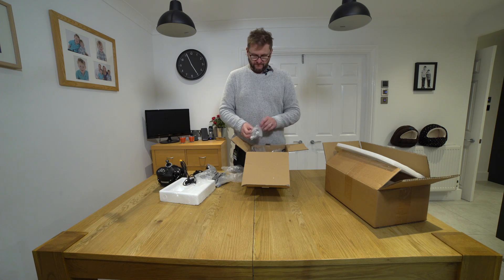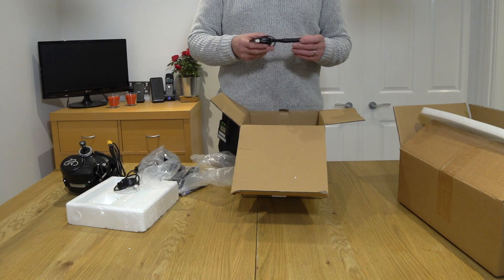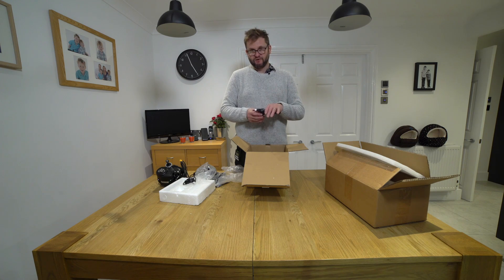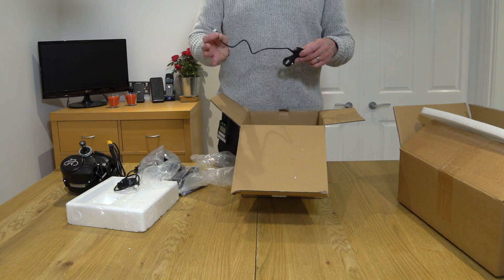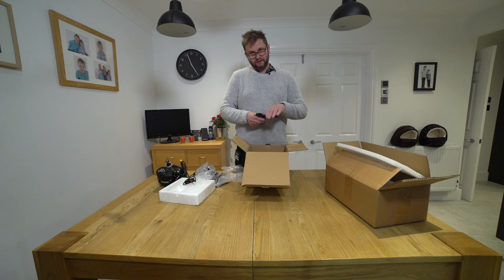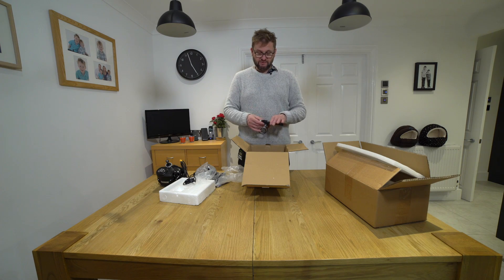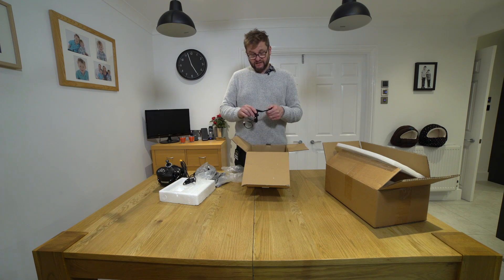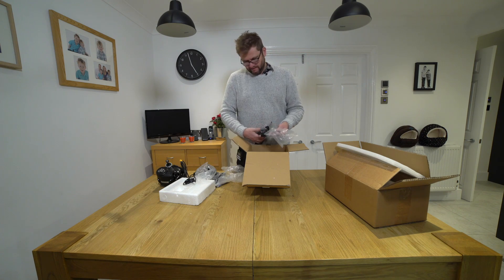So one thing immediately strikes me: if we're going to use these brake levers - which I think we should - there is a danger with an e-bike that you pedal and you brake at the same time, and of course you're going to wear your brakes out and it's just not a good idea. That's why these kits come with these brake levers, because they've actually got switches in them. Once you connect those into the control unit, that will stop you from actually being able to power the motor when you have the brake pulled. The current donor bike has brake levers with gear selectors built in, so I'm going to have to buy a separate gear selector system. These brake levers are actually nice quality - they're metal, probably an improvement on the ones on the donor bike.